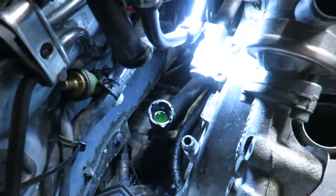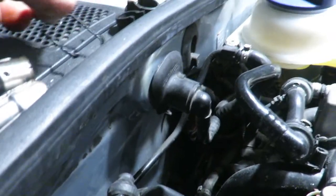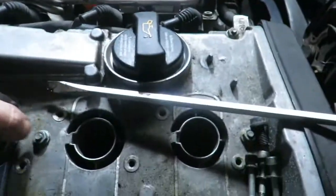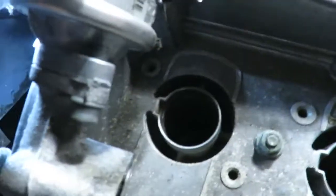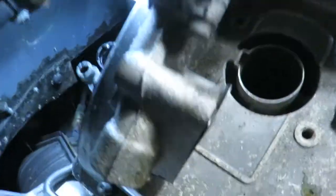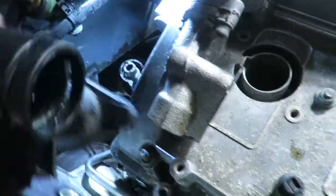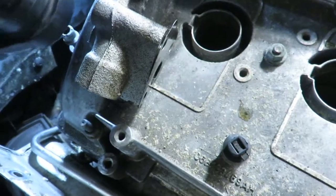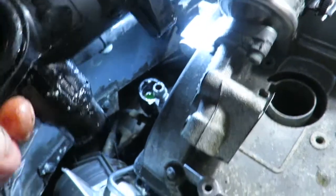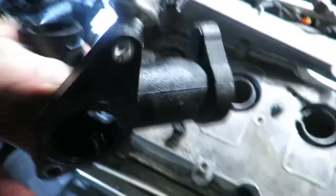So on the hose on the bottom, which is right there, I had to take this retaining clip completely out. And then I just gently pried with a long screwdriver. Let's see, it would go like this. Just along the bottom. No, it would be like, wait a minute, come on. How'd that go? Like this? Yeah. Be like that. I just pried like that real gently, and now the part is removed.